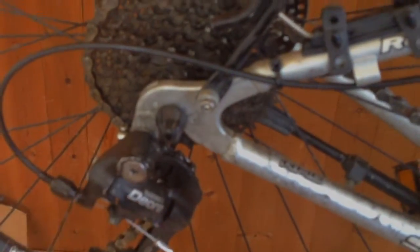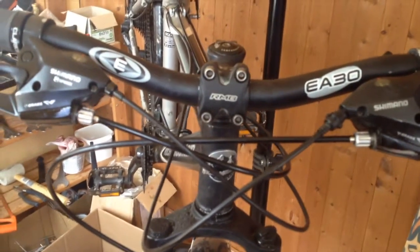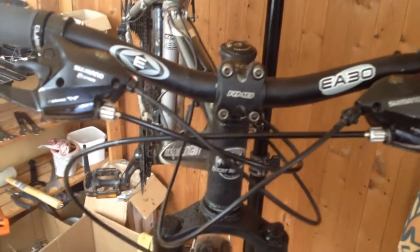And so that's because on the thumb side, it's your thumb that's pulling on the cable, which is quite powerful. When you're upshifting, it's the derailleur spring which is pulling on the cable, and that derailleur is a lot less strong than our muscles, and so there isn't enough force to actually pull through the ice, and so you'll be able to downshift but you won't be able to upshift, and not being able to shift when you're on your bike is extremely frustrating.